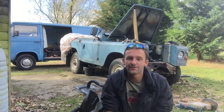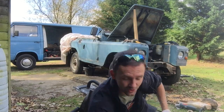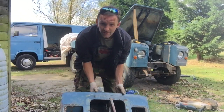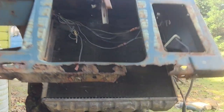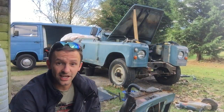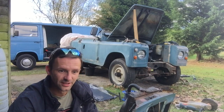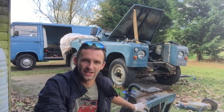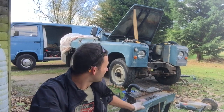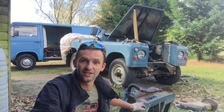Okay, so that's the front panel and the radiator out. In a minute I'll show you what condition they're in - they're not too bad. The front panel unfortunately on a Land Rover Series 3 is not aluminium, it's steel, so rust is a problem. In the end I did just cut through the wiring harness for the front lights because I just couldn't get it free, but it's been well bodged before - there was tape all over it and a push connection, so a new one of those is a good idea. Next I'll show you the front of the Land Rover without the radiator on, and then we can start looking at getting this engine out finally.